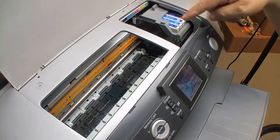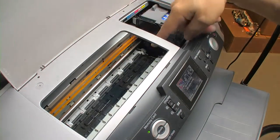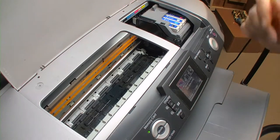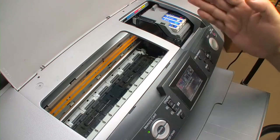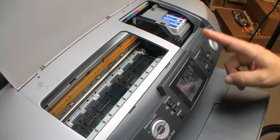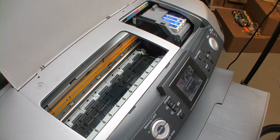You can see there's a little bit of a blue area here and a yellow area on this end over here, and that is typical as the channels are separated by color. So let's go ahead and do a nozzle check — I've already done one cleaning cycle but have yet to do a nozzle check.